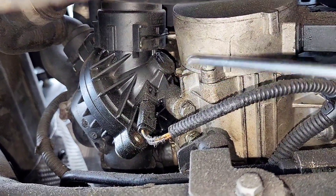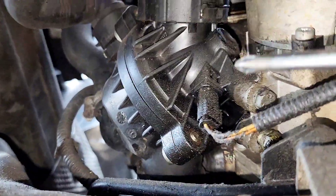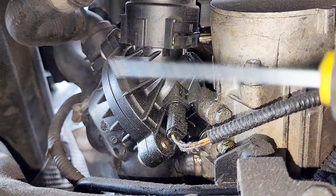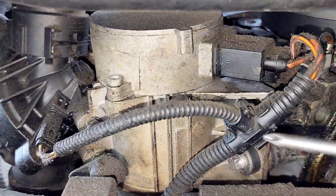It's on Amazon for less than $200. Whenever you do this type of job to replace this pump, I recommend you change the thermostat with it — change this piece here as well.